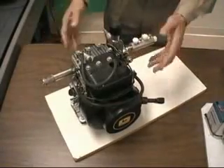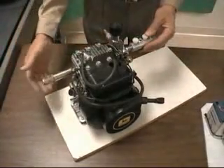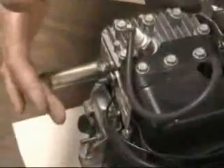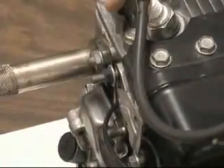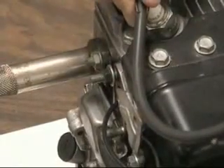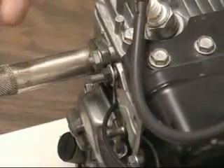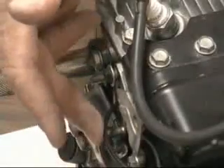We're showing how to make a very inexpensive conversion by removing the carburetor and letting the engine breathe without restriction — all the air it can get on intake — so it'll have more air in the compression stroke and more air available for burning more fuel. This is the five horsepower John Deere shown in the least expensive conversion mode, just using a delivery tube to bring the hydrogen right to the intake valve port.